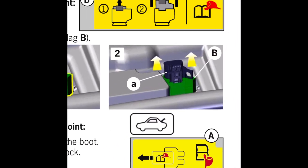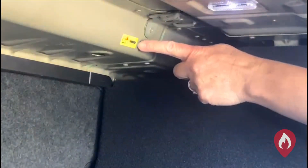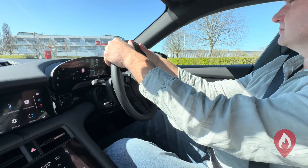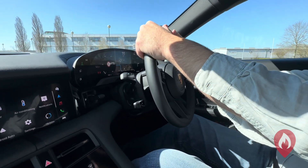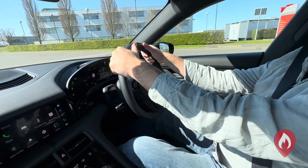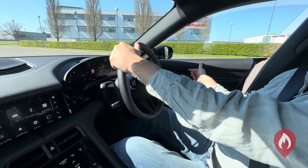To immobilize the vehicle, obviously chock the wheels first, then isolate. Open the bonnet and just there you can see the green pull plug. There's also a second pull fuse in the boot — look for that little yellow sticker, and it's just under that panel there. Now in some electric vehicles, when you open the driver's door it will actually immobilize the vehicle and put it into park. So we wanted to test that with the Taycan — here's Dan doing some stunt work. We drove along and then he opened the door, but the car still moves along with the driver's door open.